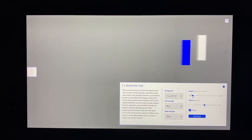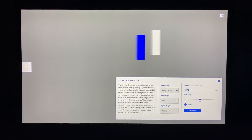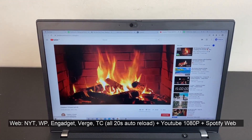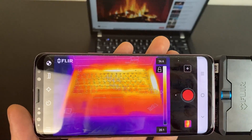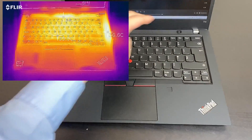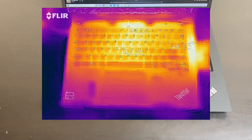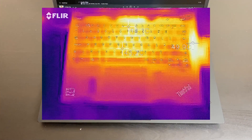In the future, it would be nice if we could have higher than 60 Hz refresh rate on ThinkPad displays. In the meanwhile, it's probably easier to get an external display with a high refresh rate if you need one. To get a better idea of the temperature, we've played Spotify for the last six minutes along with a fireplace video as well as five news sites refreshing every 20 seconds. On this chassis, as you can see on the heat map, the hotter aspect is usually around the vent. The center can also get a little bit hot, as well as the back, but the palm rest is workable. We've attached a separate heat map to show the less good case scenario — this is when we were running the benchmark, pretty much a full-on workload for 30 minutes. That one gets a little bit toasty.